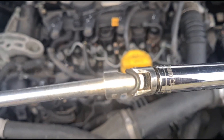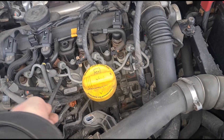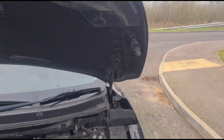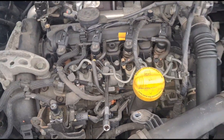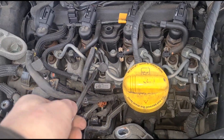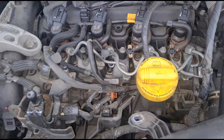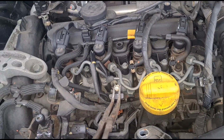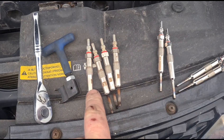Using a 10-inch ratchet — I've got a little O-ring around there that just keeps the swivel stiff so I can control it and get it down there. I do have a proper glow plug removal set somewhere in the van but I can't seem to find it. We've just had our delivery from Bennett's of glow plugs, so we'll get those fitted once we've got the old ones out. Number one out, on to number two — the angle on this one is a little bit to the side because of this fuel line here. I've pulled the socket out with the pliers and then pulled the glow plug out. Okay, so we've got all four glow plugs out.